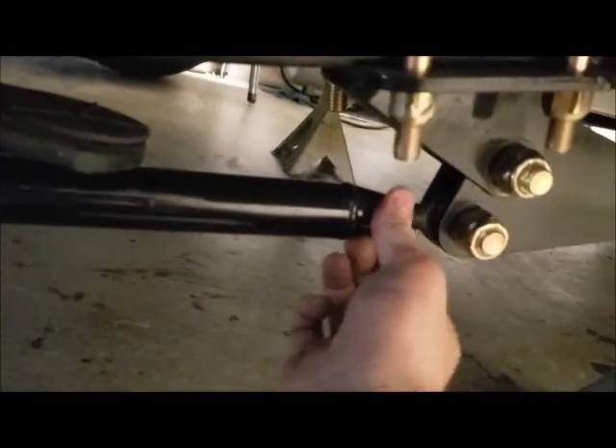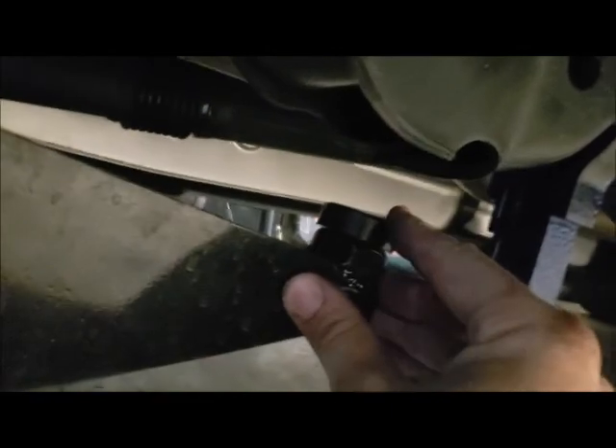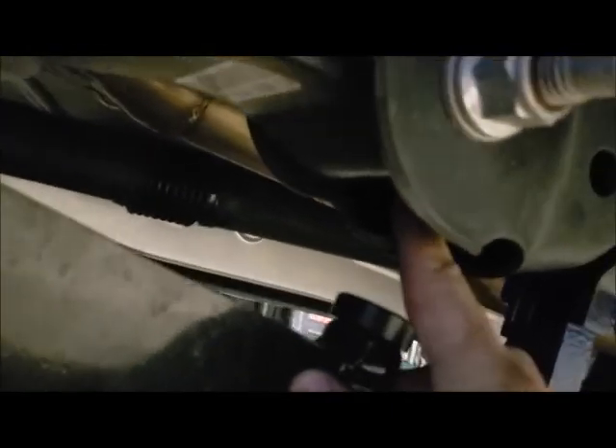This one is fully adjustable — those two nuts right there. You can tighten it all the way up, your bushings all the way against your spring, or you can leave it a little loose. I got my truck up on jacks so it's down all the way touching — I got it tightened up all the way. It definitely helps out when you're launching. But you can loosen it up and just drive around town — going over rocks and stuff won't be making any noises.